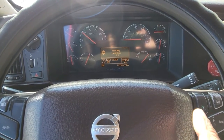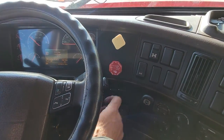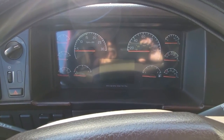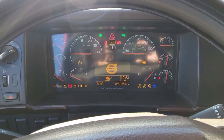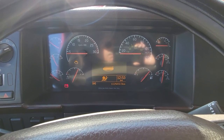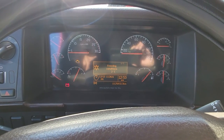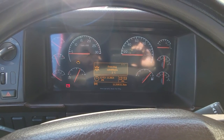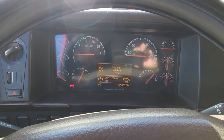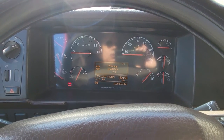My compressor stopped. If my compressor does not stop in between 117 to 137 psi, it's minor. Then we have to turn off the engine. Turn on your switch. Wait for the gauges. Press your brake and listen outside, by watching your needles. I couldn't hear any air leak. Needles are stable. If I lose 4 to 6 psi, it's minor. 7 plus, it's major. Then start your engine.